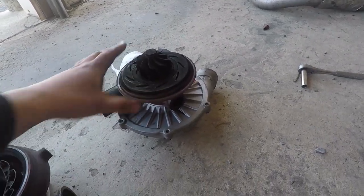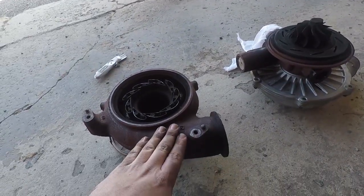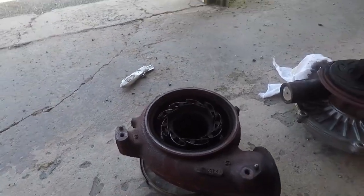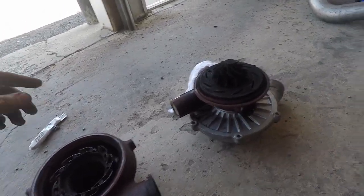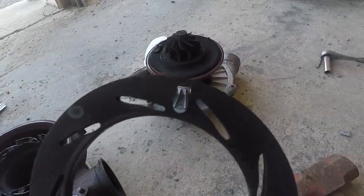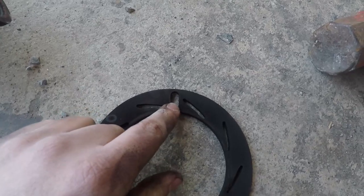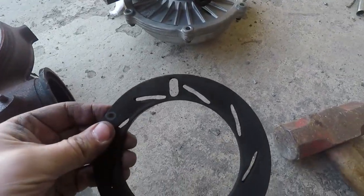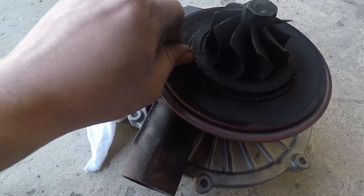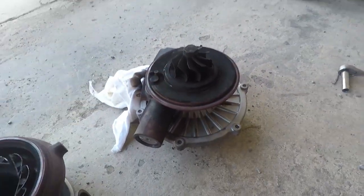The next thing is the unison ring. This is normally on there, and all you do is pick it up with the exhaust housing down and just hit it with a hammer. There is a clamp around it that you want to take off first, but that's really all you do - pretty simple to get this apart. The first thing I like to check is this hole here - you want to make sure it isn't oblong, like wide. That's how it's supposed to be, and this one is perfect. There's nothing wrong with this at all. It sits on this plunger here, and you want to make sure this isn't sticking - this isn't sticking, that's perfectly good, no issue there.